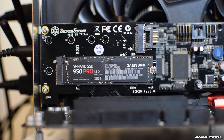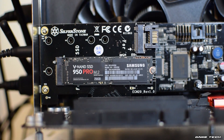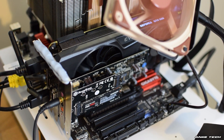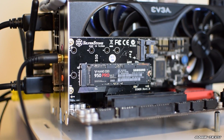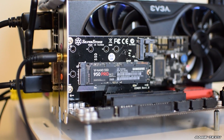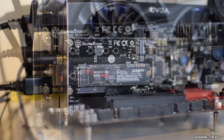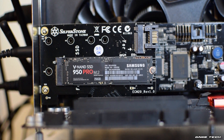This is indeed very impressive and really does demonstrate that you need a Skylake board to have access to the much faster M.2 port, or if you want to stick with your current platform, you definitely need to pick up an M.2 to PCI Express x4 expansion card. My PCI Express x4 expansion card is the Silverstone ECM20, which features both a standard SATA M.2 port and a PCI Express M.2 port.